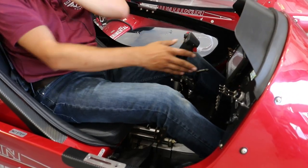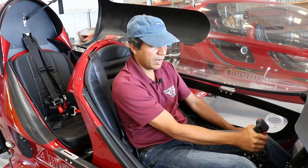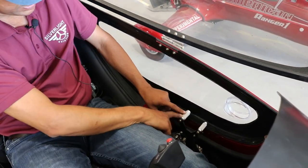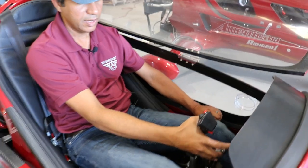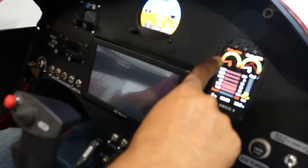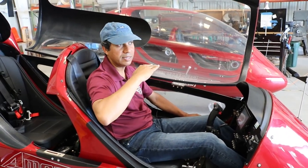If I squeeze this bicycle handle, you'll see at the back there is an arm that gets depressed. And that tightens the belt, and it actually starts to pre-rotate right here. While pre-rotating, I am going to take my left hand — the brake is right here. I call this the taco. I will taco my hand and hold the brake, and I'm going to control the engine RPM by moving my taco front and back. I'm holding the brake the whole time. It takes a minute for pre-rotation. I'll squeeze this, and then I'm slowly increasing engine RPM, watching the rotor RPM that is right next to engine RPM right here. As the rotor RPM stops increasing, I'm going to increase the engine power just a tad, like 200 engine RPM at a time. Let the rotor RPM catch up, get the torque transfer happen.